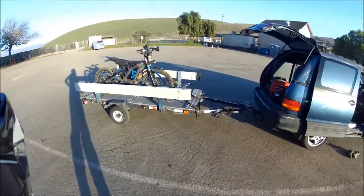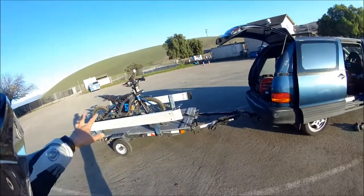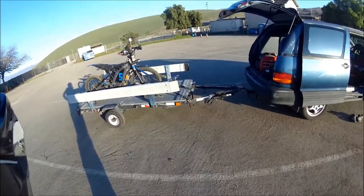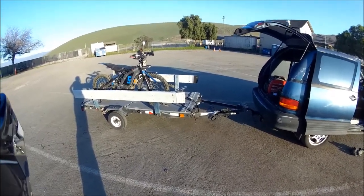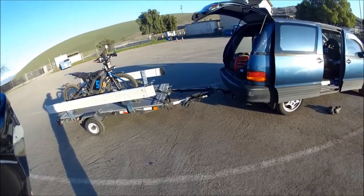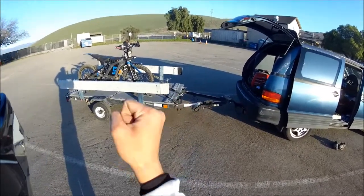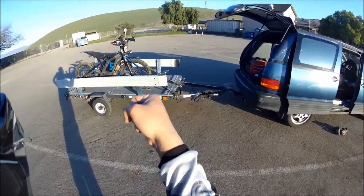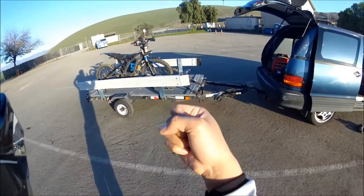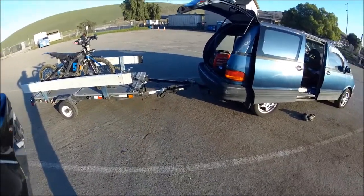A little AAR. Well, this is going to be the AAR for riding the bike with the regen on there, with the variable throttle regen. I like it. I like it a lot. It's a lot easier to control than off-throttle regen. With the off-throttle regen, I feel like I'm kind of ham-fisting it too much, you know. I'm getting 100% regen all the time, and it's just kind of hard to keep it in that regen zone where you want it.